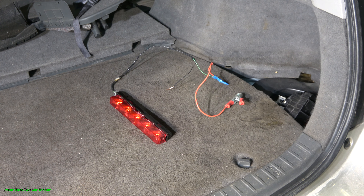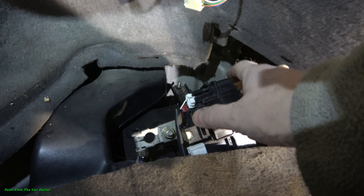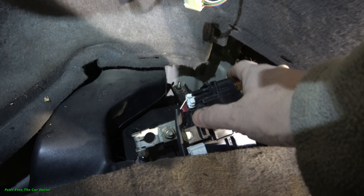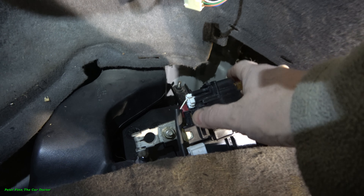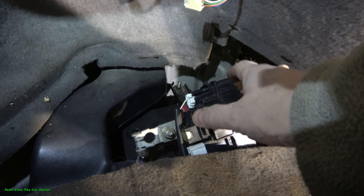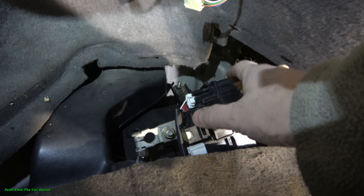Now I have really modified this Ford testing device. I have installed an alligator clamp here and connected these two cables together. This area always goes to the plus area and is red. Now I have to install electric tape here, because otherwise I can get a bad connection — which broke my fuse. I take my electric tape and cover it here to protect the connectors. Now I can use this testing device for testing.